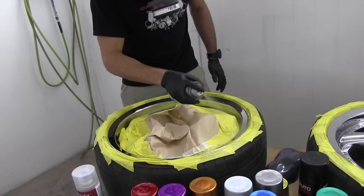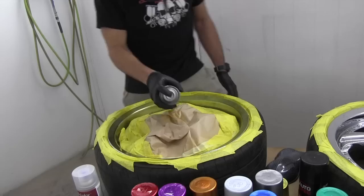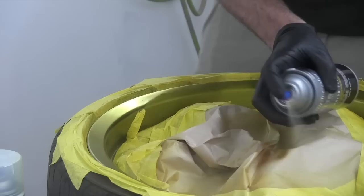When spraying this paint, it's important to apply even coats. You don't want to be overlapping too much, because that will make those overlapped areas darker than the rest of the panel and it's not going to give a uniform colour. So make sure it's even coats. It's also important to wait at least 10 to 15 minutes between each coat. You don't want to smash it on too thick too quickly, because you'll have problems.